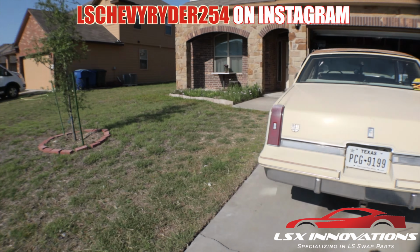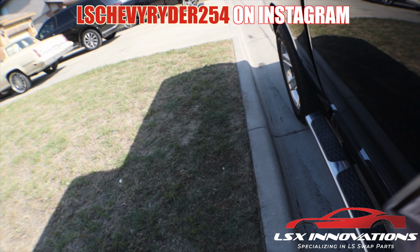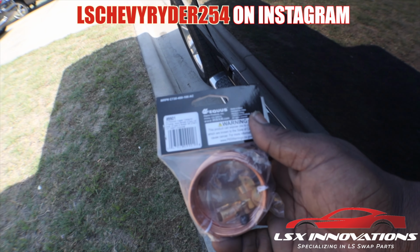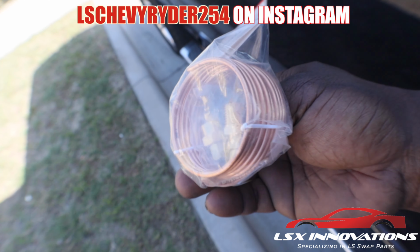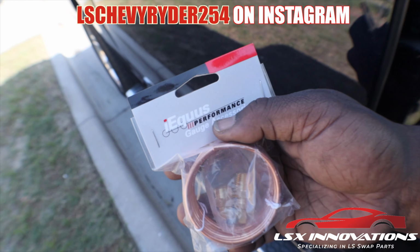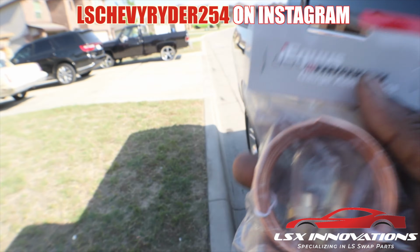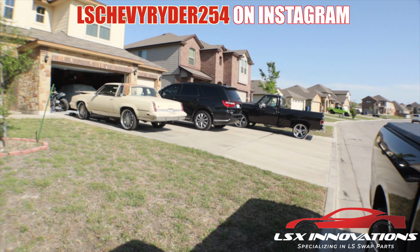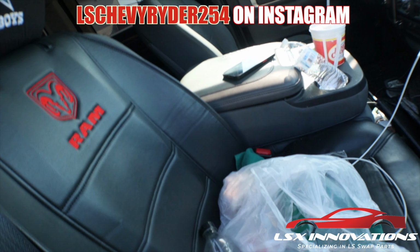Like I said, man, it's got a real bad oil leak coming from that oil pressure port in the back of the block. So I bought the Equus oil pressure tubing with the brass ferrules. I really just need the ferrules to redo the ones behind the intake, but I just bought the pack.